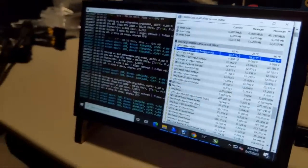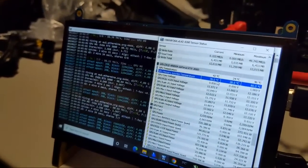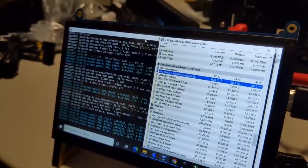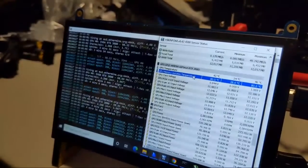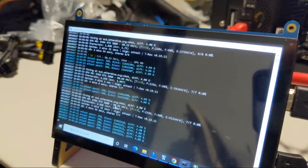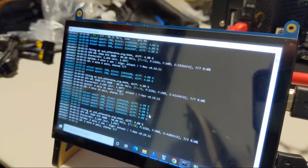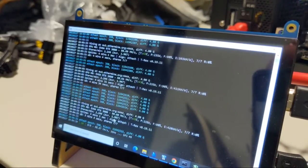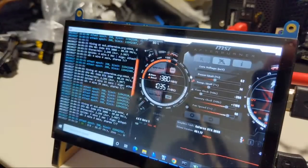Okay, all right, 78 degrees Celsius. Looks like we've gone down on memory temperature now. Okay, mega hash number though, I think we are, okay, 235 watts. Yes, 235 watts, 98.68 mega hash. Okay, so looks like we can probably go down more.